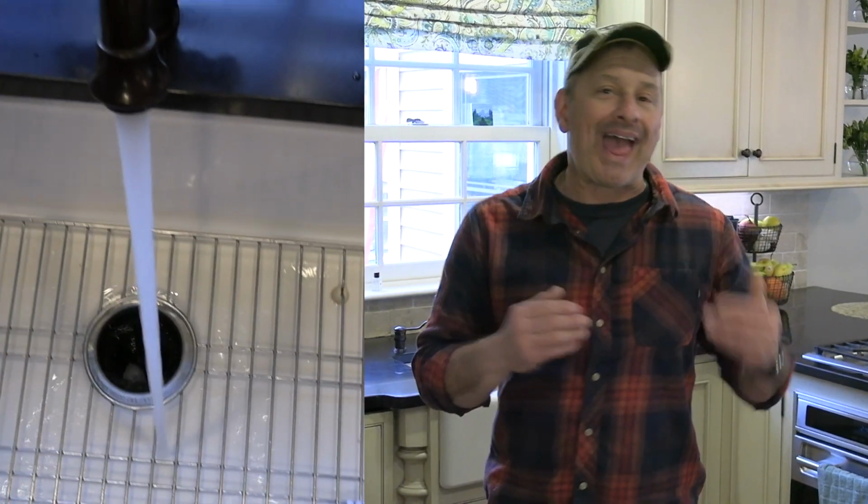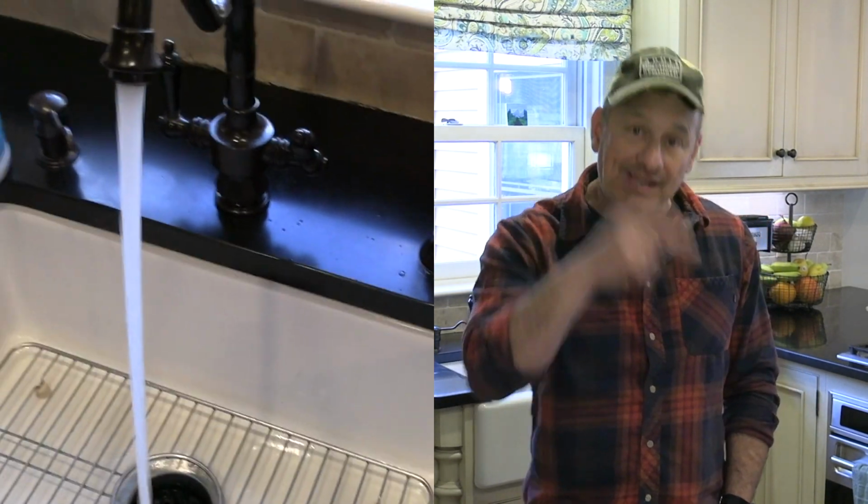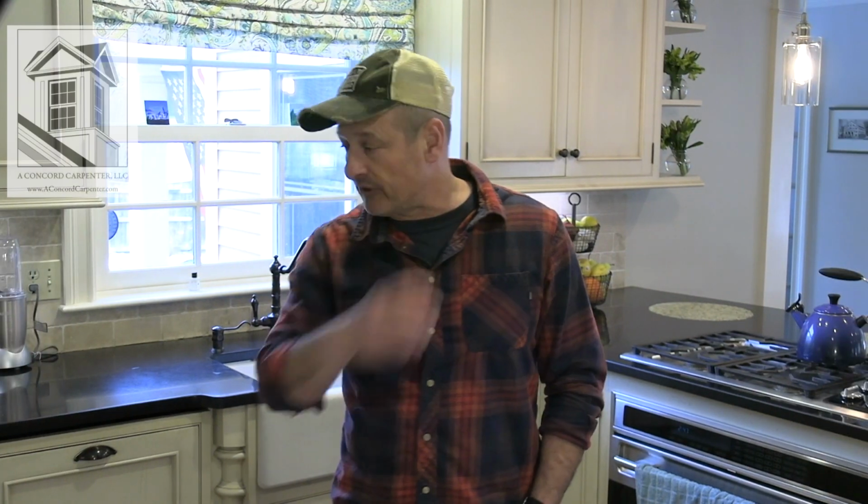There are some general uses though that you can do to keep gunk and odors to a minimum, and that is to use your water before, during, and after the grinding stops on your disposal. This will help clear the plumbing P-trap underneath the sink and allow food to thoroughly pass through everything and get out of the disposal. Beyond occasional cleaning, there's not much you can do as far as maintenance. They don't require a lot of maintenance.